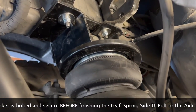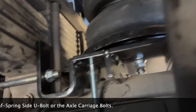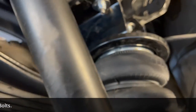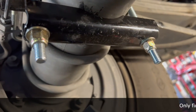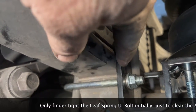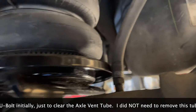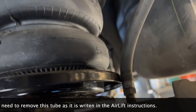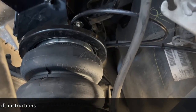The driver's side bag is installed. The base has been adjusted so it is in perfect alignment and the bolts are tightened all the way around. When installing, you have to make sure that the vent tube isn't caught underneath — it's a really close fit. And there it is, fully installed.